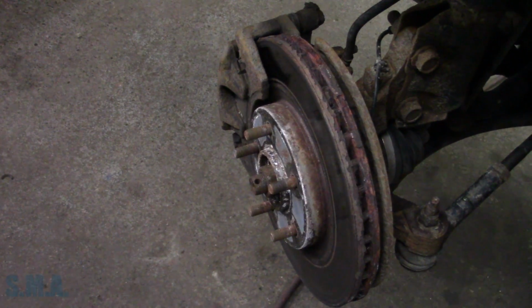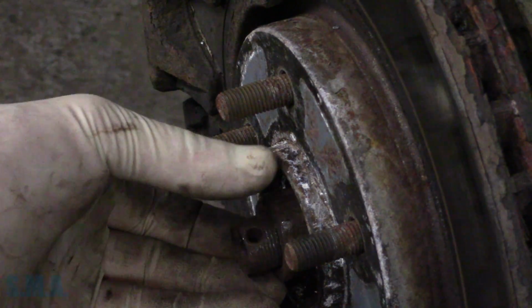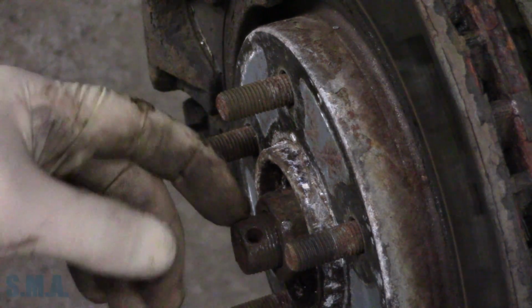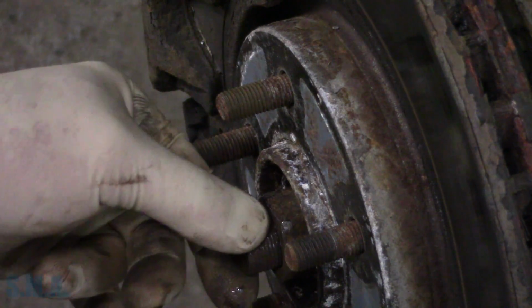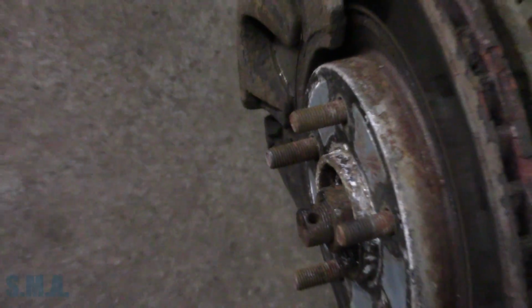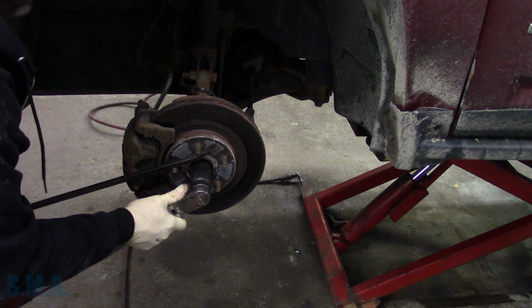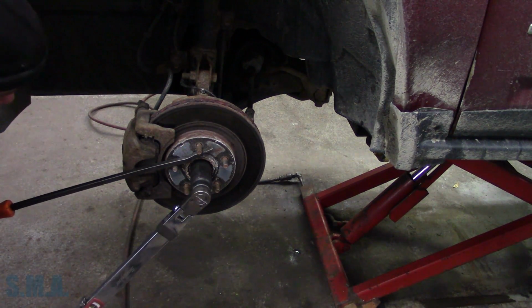I'll let you have a look. Intense. I don't believe that these had a cage from the factory. I could be wrong. I don't believe they do. I think it was just a washer. Now let's torque it down. We'll stick a big cotter split pin in there, if you will. Unenhanced. We'll go like this. See if we got 180 in us this morning.